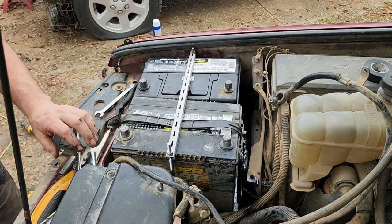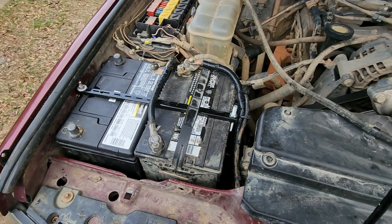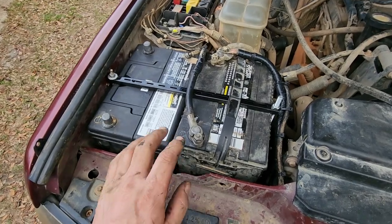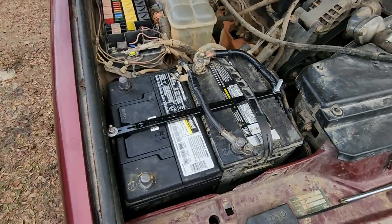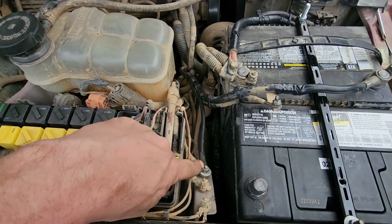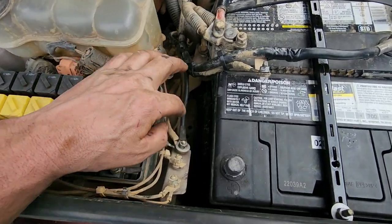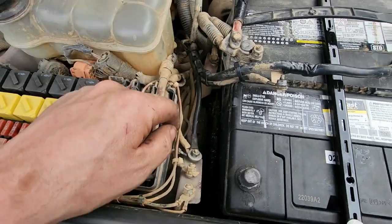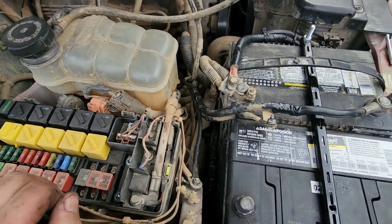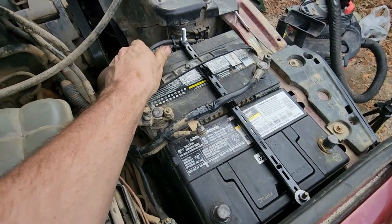There is the dual batteries installed in the Disco. By flipping the batteries the opposite way from what I thought I was going to do, I ended up being able to use all the factory wiring, which was cool. The only thing I did have to do is - this little ground strap normally attached right here, obviously it doesn't reach anymore - so I went back to my parts truck and pulled out a ground wire. This ground wire runs down to the chassis; I just attached it here, routed it down, and reattached it there. So that's all grounded the way it's supposed to be. Battery hold-downs seem to be good - they are in there absolutely rock solid, ain't going nowhere.